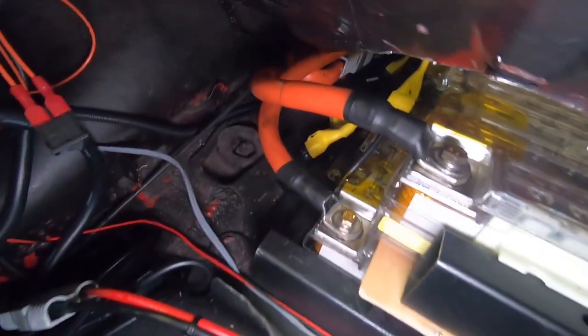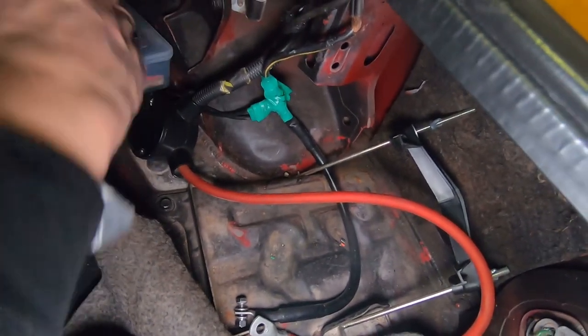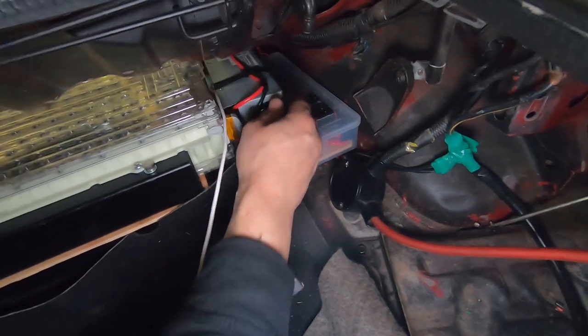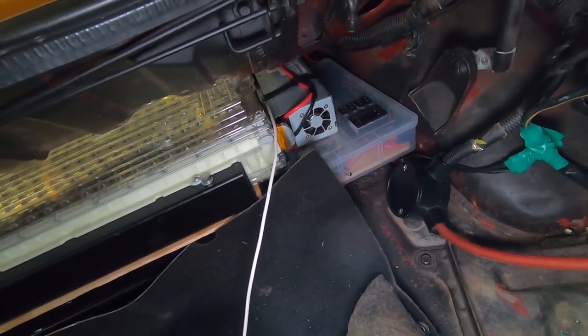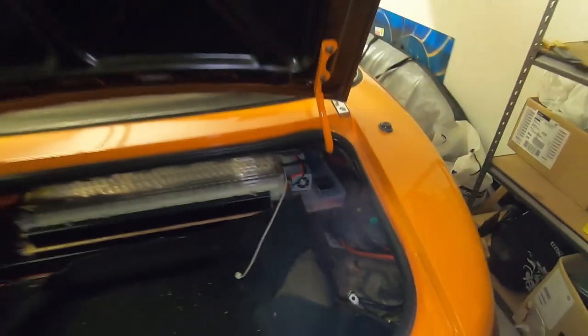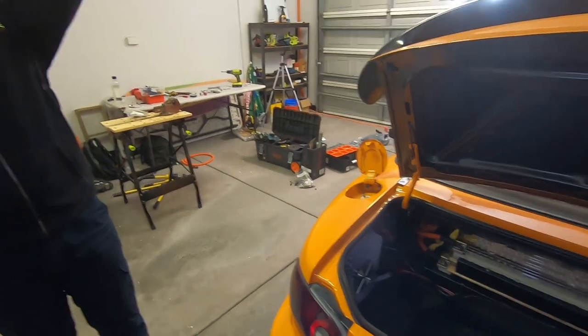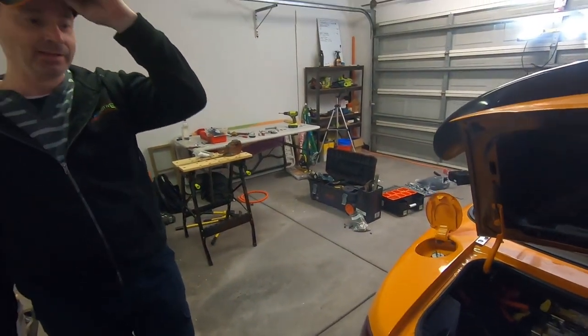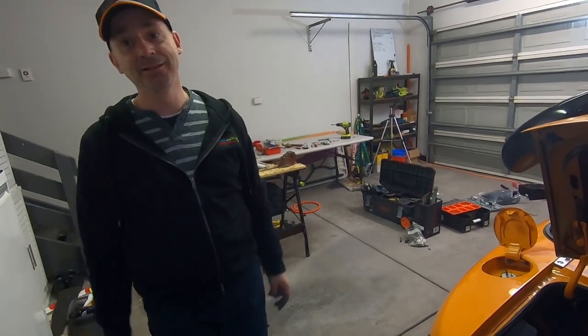Go around the back. Hey, Costa. Hey, man. It's really late. The batteries are all connected. We're missing a starting battery, which is an accessories battery. There's the DC to DC converter, which is a power supply. And we just need to cable up the Tesla modules with the Ethernet cable, serial cable. And then we can put a 12 volt battery in, and hopefully the car starts, mate.